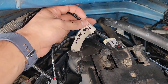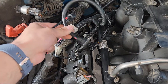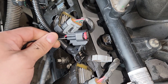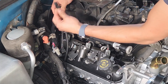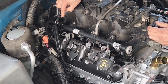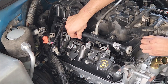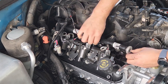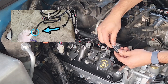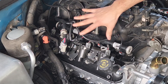With the intake installed, the MAP sensor connects at the rear. Injector adapters are needed because the LS harness connectors differ from the injector connectors — one side plugs into the LS harness, the other into the injector. Starting from the rear injector and working forward, each adapter clicks into place on both sides. On the passenger side, the longest injector harness connection goes on the very front injector. All passenger-side injectors and coil packs are now connected.